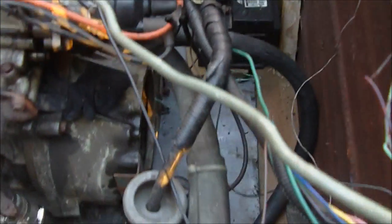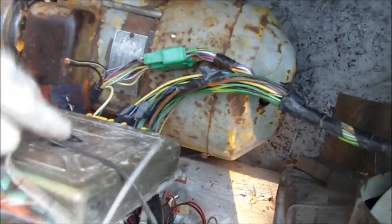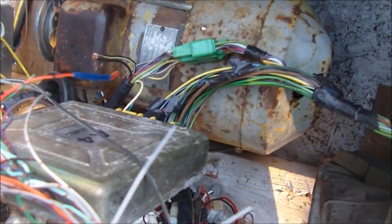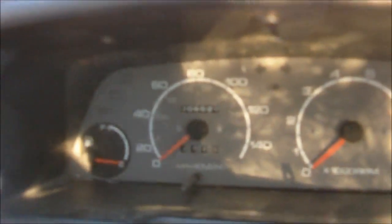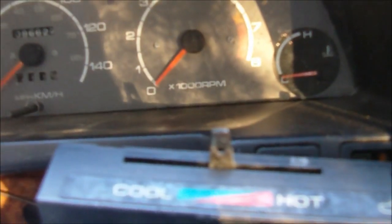I've used all the wiring from the car — this was out of a 1990 Pontiac Firefly. I've utilized all the wiring; you have to have the control modules and all that because it's throttle body fuel inject. I've just installed all the instrument cluster in here as well because I want to have the RPM and the temperature gauge. They're not working right now, but I'll have all that working once I clean up the wiring and connections. The fuel gauge will be useful to have as well.